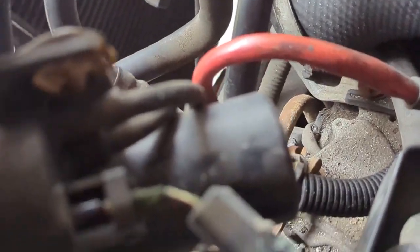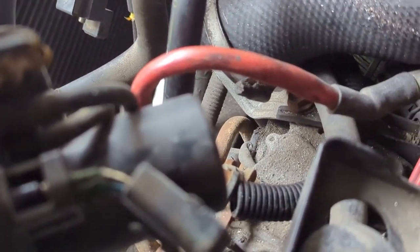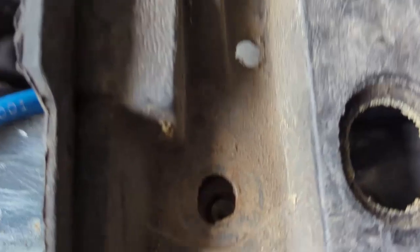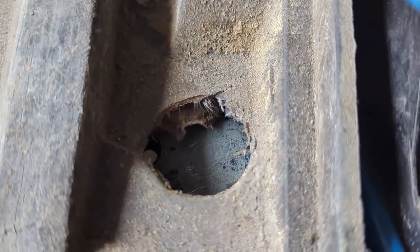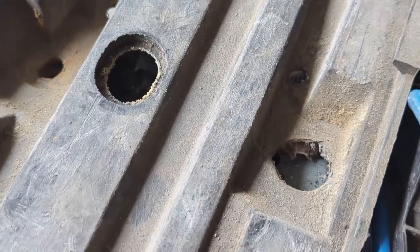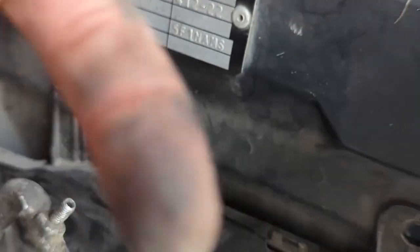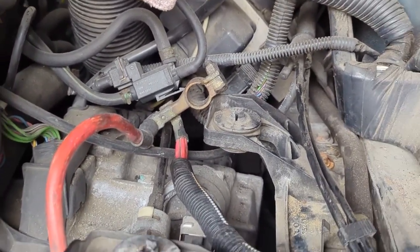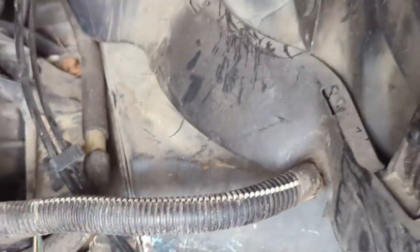Next I'm going to hook the battery tray up and make sure I hook up the cruise stuff to it. The wire harness to the cruise pump has wires eating up the rubber, so we plug each prong in and now we're going to slide the connector housing on. The battery tray is not lined up perfect — I've got a hole there, a busted-up hole there, and the bolt hole still isn't lined up. Somehow the bolt holes don't have the spread they used to have. This part of the inner fender apron is pushed out and needs to be pushed in, but we're not going to worry about that. Hopefully, even though the battery tray is now cocked back a little bit, I'll still be able to get the battery and the air box in without them interfering with each other.